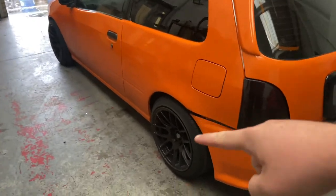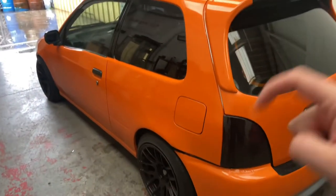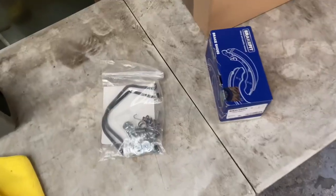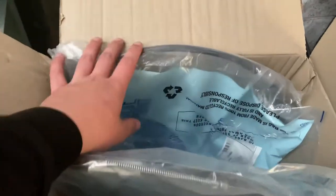So first of all, we're going to jack it up, take the wheels off, disconnect the handbrake underneath, but loosen it off, and just get straight into it. So here's the fitting kit, the shoes, and the two handbrake cables. So all the links will be in the description for all of this.